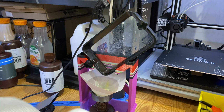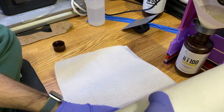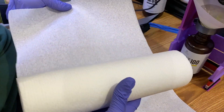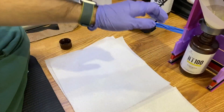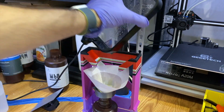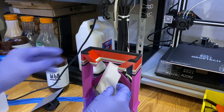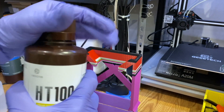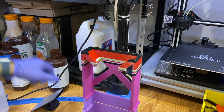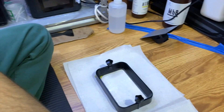The vat screen is almost empty, so I'm going to put some paper towels down for removal. Then I'll take the vat and put it on top of the paper towels. The filter goes to the trash since we don't have any use for it. I'm going to clean the funnel with IPA and close up the old resin bottle. The work with the holder is done.